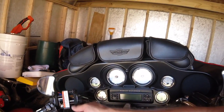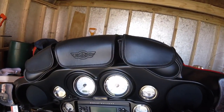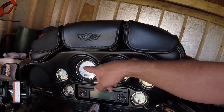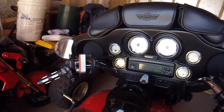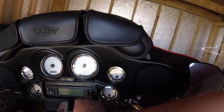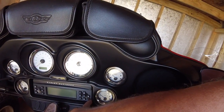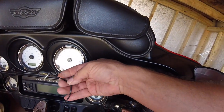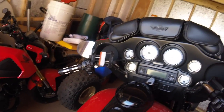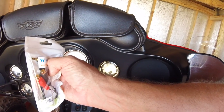I've got your typical Harley phone mount right here. I used to use a little cable to listen to my music. The Hogtunes did have a good idea — they use a 90-degree RCA 3.5 auxiliary cable, plug it in right there and tuck the cable back in behind. Just make sure everything is routed carefully so you don't end up cutting your wire. What I've got is a simple 3.5mm to female RCA adapter.